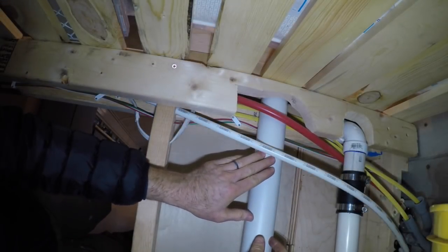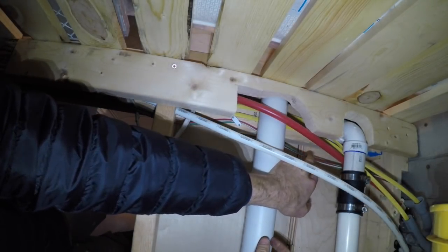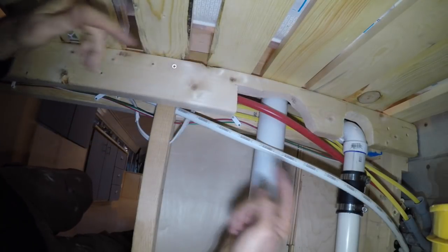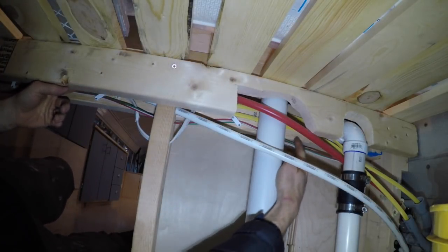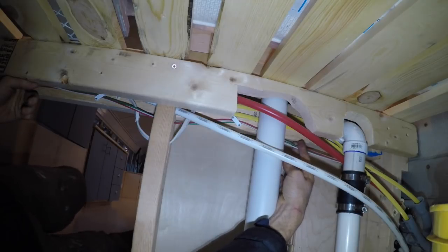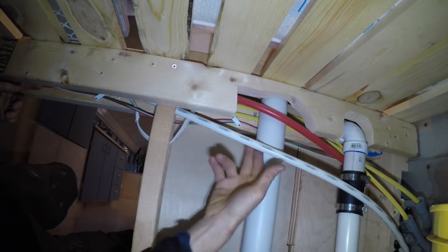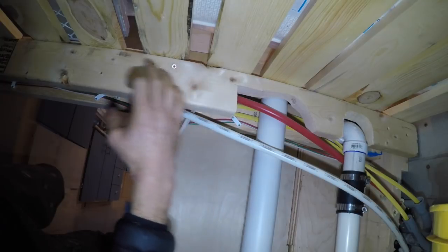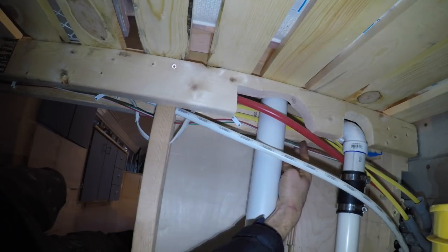Here's my solution. Under my bed, my theory is that this 12-volt run right here is the one that at some point early on in the build I tugged on and pulled it out of the conduit. So I'm going to cut it at a place where I can splice it — right over here. Then I'll have this loose end and can run it back down through the conduit, and hopefully it will pop out on the other side. If that happens I can add a little bit of wire, put a junction box here, connect that wire back together, and we should be alright.